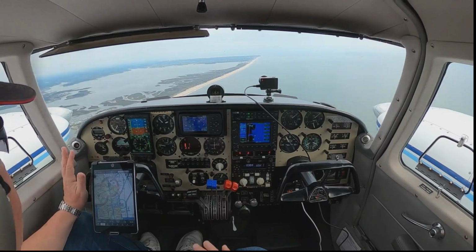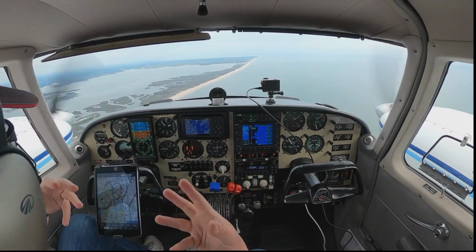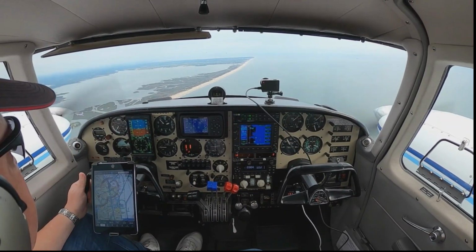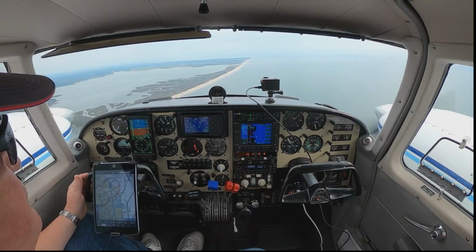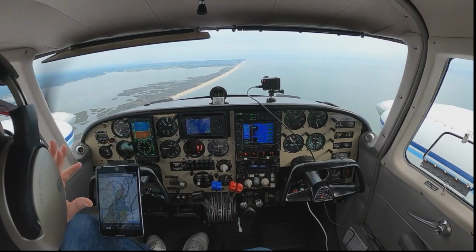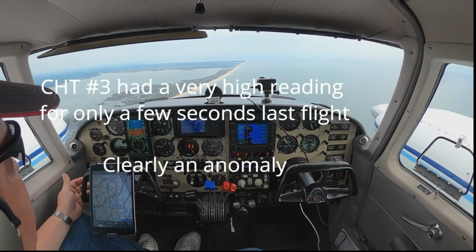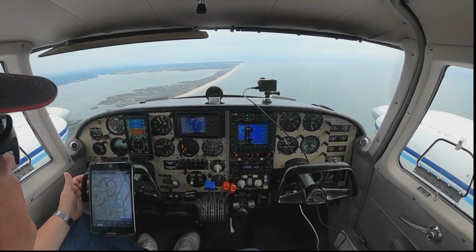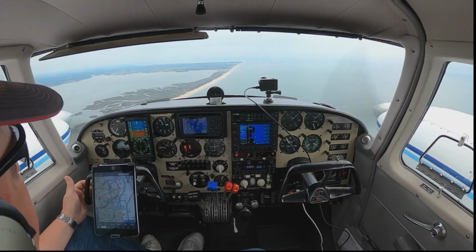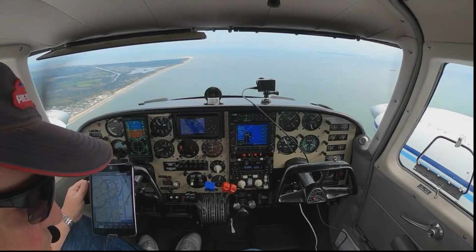Okay, so I'm going to ignore CHT-3, even the alarms that come in. Boy, you get an alarm on your brand new engines, that'll start your heart again. And I did see one of these blips on the last flight, and talked to my buddy Mike, and we went over the data, and it's an anomaly for sure. You can see this thing going all over the place, so I'm sure it's just a connection issue.